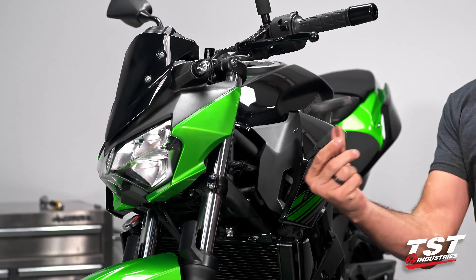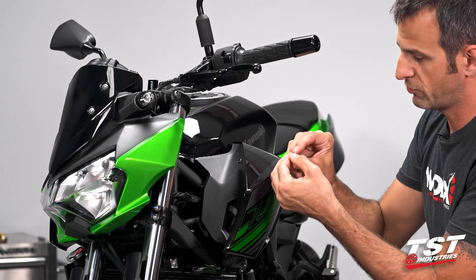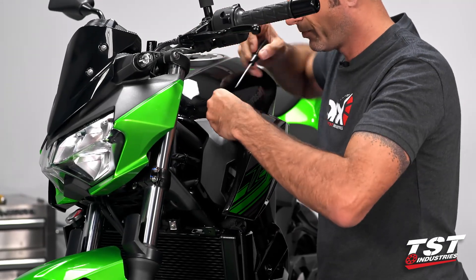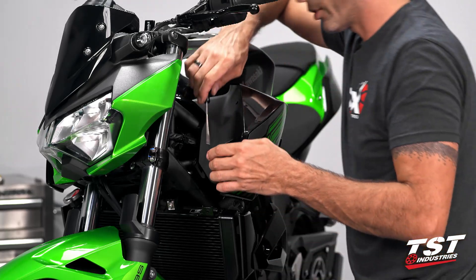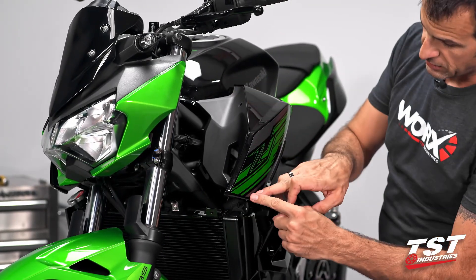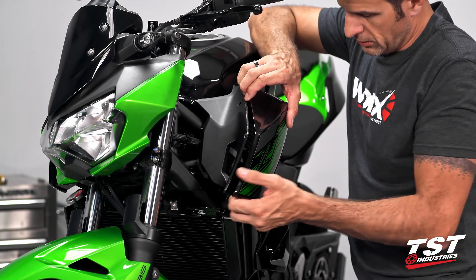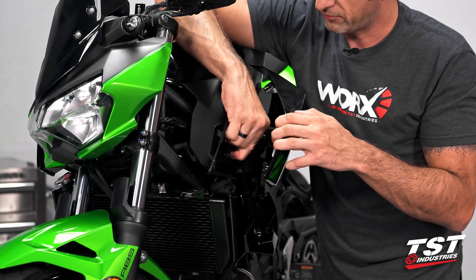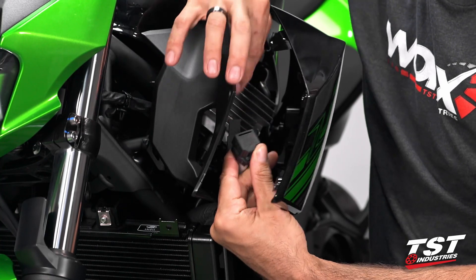In step one, we will be using a four millimeter allen key to remove this fastener up here. When you extract it, there is a small plastic washer that goes with it — please retain it and reuse it upon reassembly. Now we have three rivet type plastic fasteners. You push in the center to get them unlocked and extract them, then reset them for reinsertion. Now we will unlock this panel from its captive fasteners. There's a series of peg-type fasteners that go into rubber grommets — we just need to dislodge them. We won't actually remove the entire panel off the bike; we just need enough access to slip off the OEM relay.